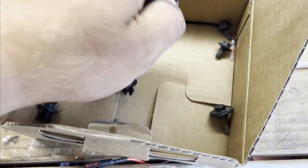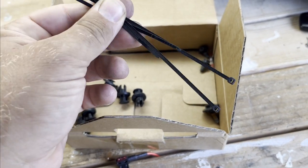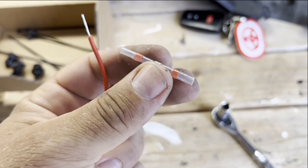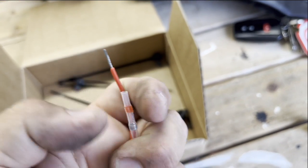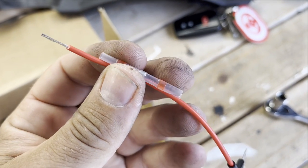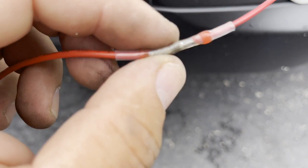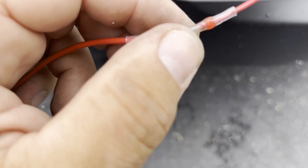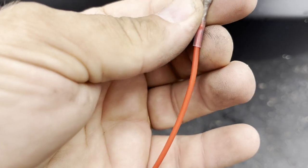You can take these zip ties to zip tie the cables, but before I do that I want to make sure these lights work. So I'm going to connect the lights into the fuse box and to the ground. Car Trim Home provides this shrink wrap — when you connect this cable to the positive at the fuse box, you heat up this piece with a lighter and there's a piece of lead that fuses these cables together. So this is done — I already did that with a lighter. Let's connect it to the fuse box.